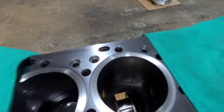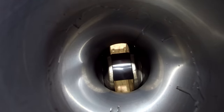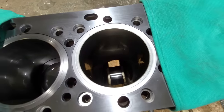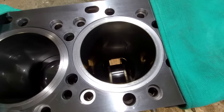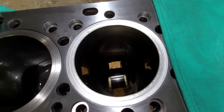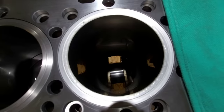Got the upper part of the cylinder all coated. I install pistons with the rod journal up at top dead center. There's a lot of guys that do it the other way around — I've tried it every which way, and this is by far the way that works best for me. The problem with these engines, and especially with these one-piece steel pistons, is if you put the rod journal at bottom dead center, as soon as that rod-piston gets fully into that cylinder you don't have any control over it anymore and it'll slam straight to the bottom.